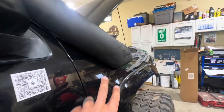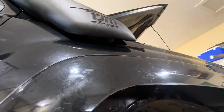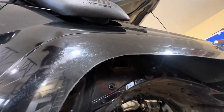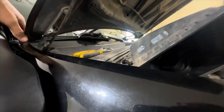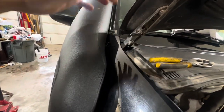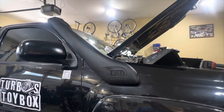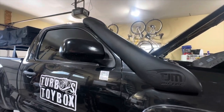So that's just kind of sitting in there — I've pushed the two pipes together. The inner fender intake pipe is loosely bolted to the inner wall where it needs to be, and then up in the back where it angles, they're just slid together. I need to pop that back apart and put some paint around the edge of all that bare metal. On my application the antenna obviously wouldn't work, so I'm just going to paint the edge of the bare metal — you're not going to see it under the snorkel anyway. I primarily only use Bluetooth through the stereo, so I don't really listen to local radio.